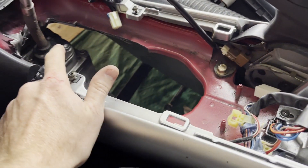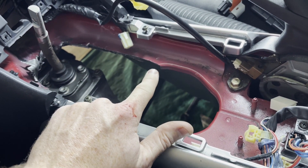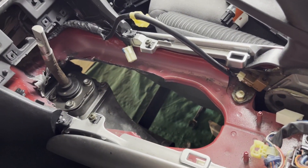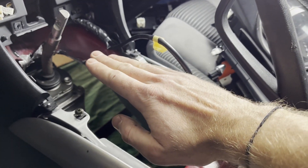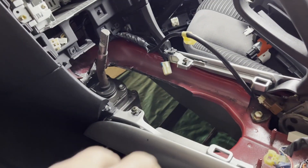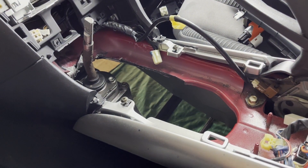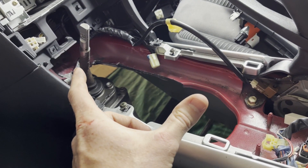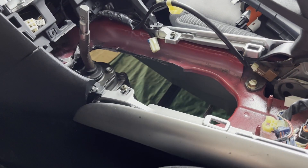What I could have done — and this would be the incorrect way — is just weld a right angle on that shifter, bring it back here, and weld another right angle up and have one solid piece. The only problem is that whenever you're shifting, you get weird translation between the two points. When you shift forward your linkage goes like this, and when you shift backwards it goes like this, and you get some weird angles. I don't necessarily know if it's bad for the transmission, but it might be hard to get in gears and just won't feel totally natural.